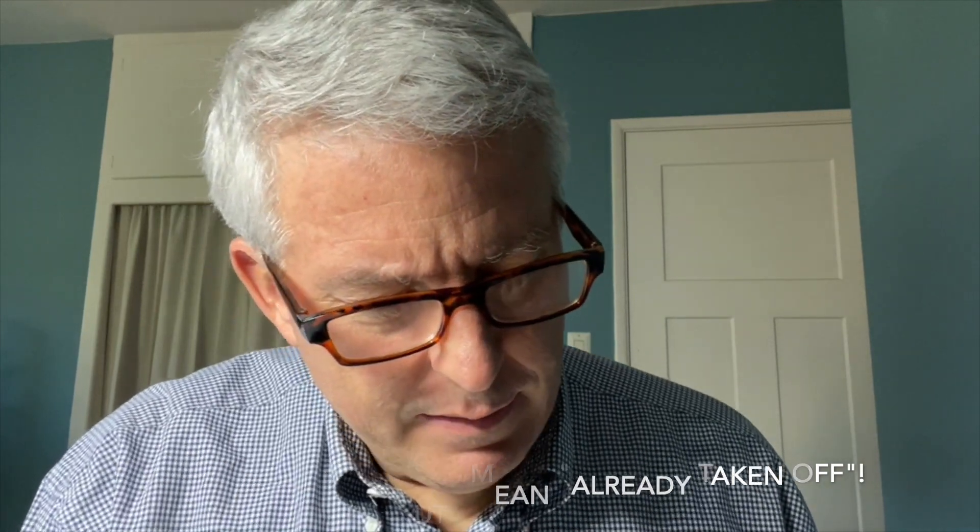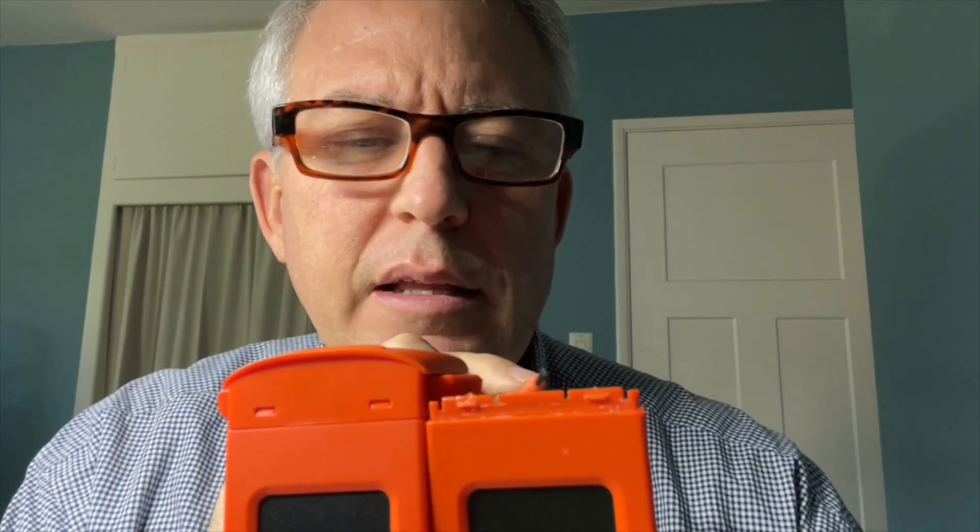After breaking off the back panel, here's what it looks like when you pop it open. Where those indents are there's a little piece that sticks out — you need to come in from the inside and pry those things forward. I used small Swiss needle-nose pliers with really fine tips, which was just enough to reach underneath the cap and grab hold of the plastic piece, pull it forward, twist it, and break it free. Once I got one free, I held it and pried the other side to pop it out.